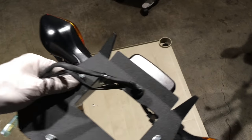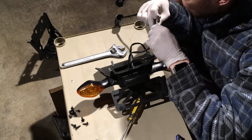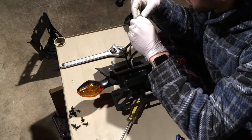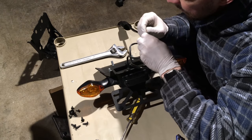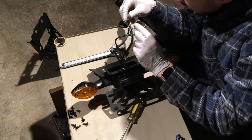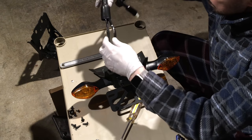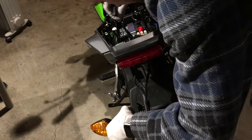Reconnect the wire harness. Push the brass fittings all the way into the hole — it's absolutely important they seat fully to keep them from vibrating free. These are the wires to your turn signals, so you want a nice snug connection so people get a proper safety warning of your direction. Match the colors: orange to orange, blue to blue, and the big connector takes both greens for the ground. Double check everything, slide the boot over the connectors, then feed the wire assembly back into the rear fender and fender eliminator, folding connectors to shove them through the hole as before.